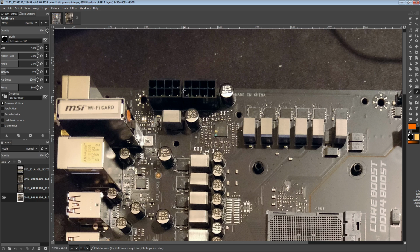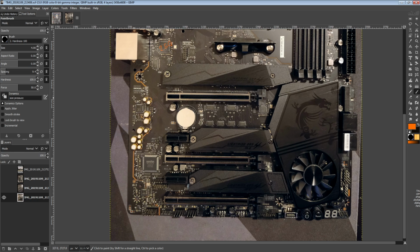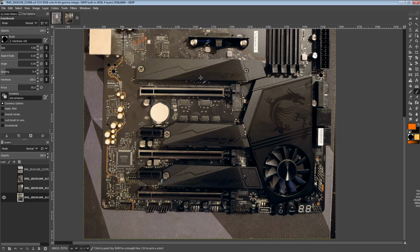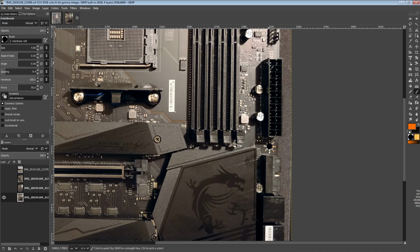So the thing is, normally, let's say you stick 3 RX 480s in this motherboard, and then you just overclock them and you don't enable the power balancing system, and you just let them absolutely wail away at the PCIe slots in terms of power consumption. Well, it's not going to be your PCIe slots that end up breaking. Nah, it's going to be your 24 pin, because the 24 pin has two 12-volt lines, and it's not capable of handling more than 8.